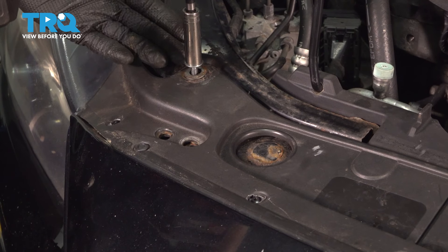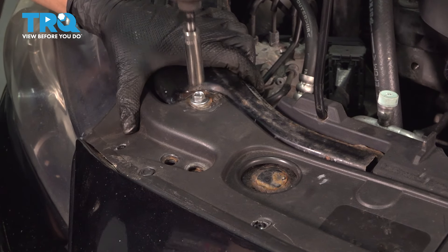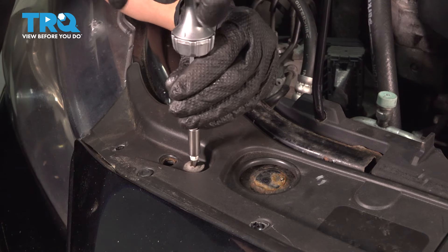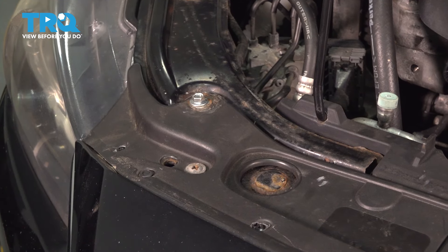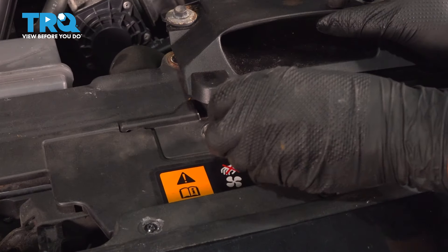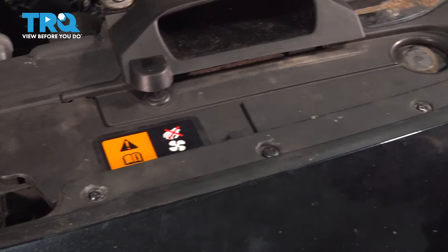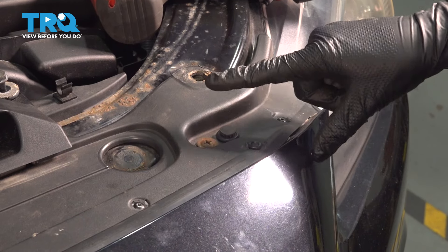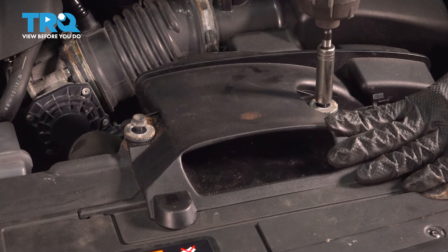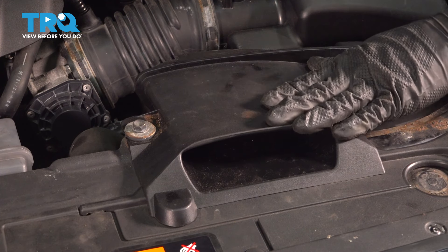Let's reattach the bumper at the top with the two bolts. Mine has a 10mm head bolt here — yours should be a Phillips head. It's a good idea to put some anti-seize on the threads of these to prevent them from rusting in the future. When you tighten them up, just give them a little snug after they bottom out — you don't need to go very tight on those. Do the same on the other side. Reattach all the push clips at the top and lock them in — just go along and re-secure all of them. Lift up the air intake here, get that push clip on, set this back down. Get the last push clip in. Take the bolts and start them back into their threads and snug this up. This is on a rubber bushing — you don't have to crush it or anything, just make it snug.